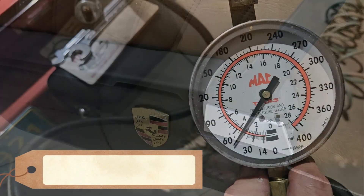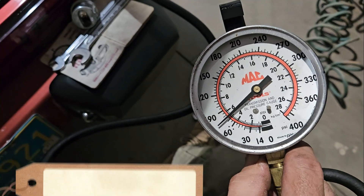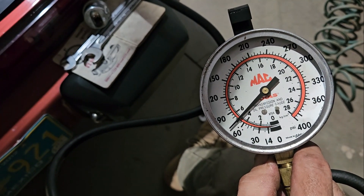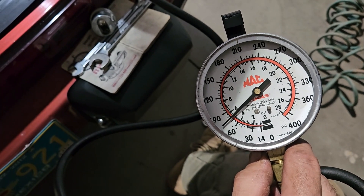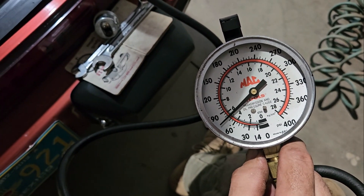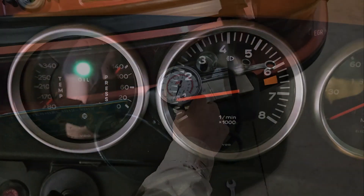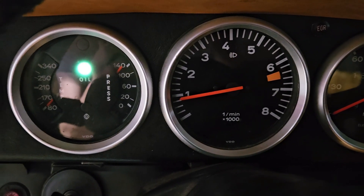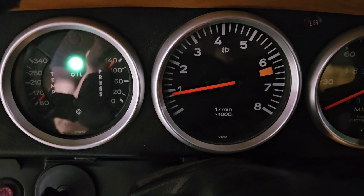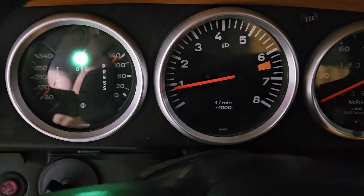Are you going to let it warm up? Nope. I'm going to put my oil pressure gauge on. This is actual oil pressure at idle — we're almost 60, revving to 2000. So right now the gauge is pink because I have it unplugged. But we have a 30 PSI difference between the gauge and actual engine cold when we perform the same test.